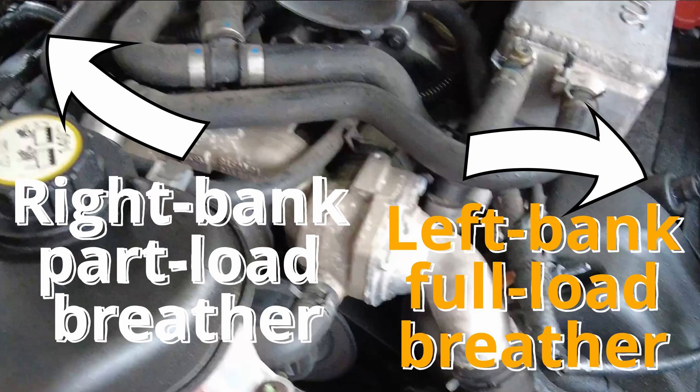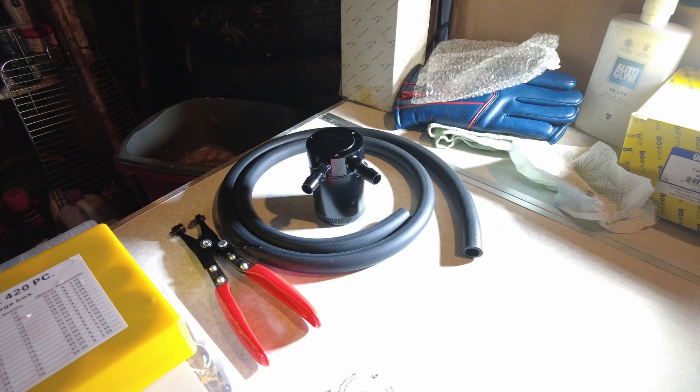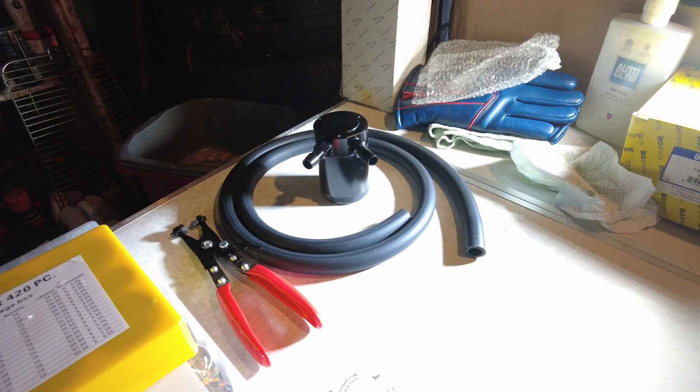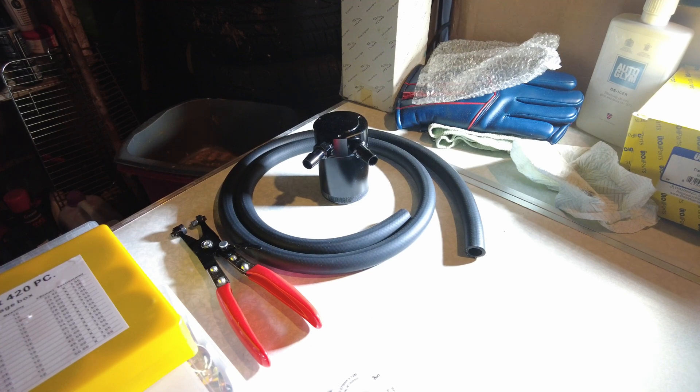The challenge is that a lot of the gases created within the crankcase can often manifest as an oily mist being vented back into the intake. What can happen particularly with the AJ33S V8 engine is that this long tube containing the oil mist and other nasties sits there for a long time. I honestly think it's dripping down just ahead of the supercharger, and when the engine starts up the supercharger spools and this forces it into the engine, which can create a puff of blue smoke.